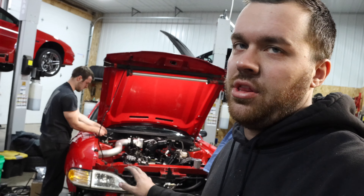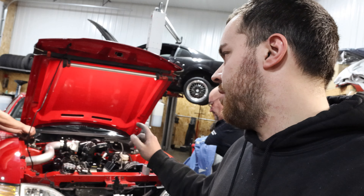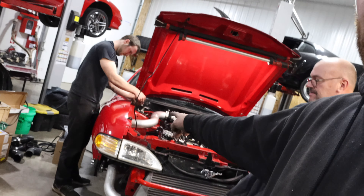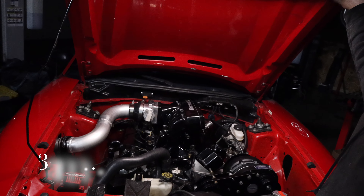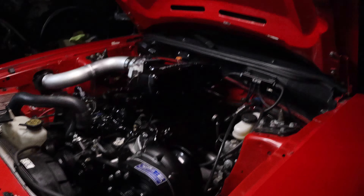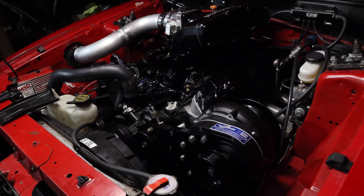Twenty minutes later — she's out, record time. The headers and whole exhaust need to get cut off — those are gone. Otherwise, just a general health check: take the rest apart, look at what's inside, check push rod lengths and make sure it's ready to go back together. Both red cars are going swimmingly well. We're going to start working on the aluminum tubing on the red car for the charge piping and getting the Camaro back to roller status.